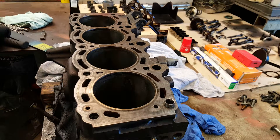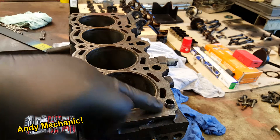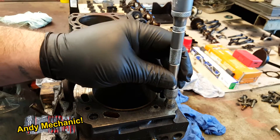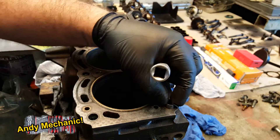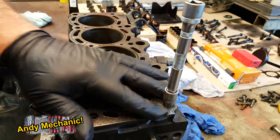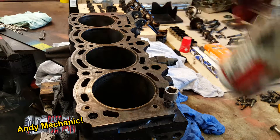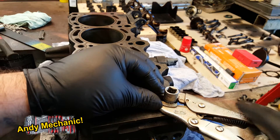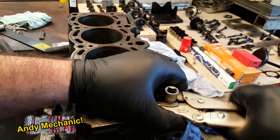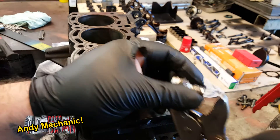This is the remaining dowel on the RAV4 block. I want to get it out of the way so I can run the straight edge across where that is. Just pop your socket on there — make sure you've got your verniers out and confirmed it's a snug fit and not too tight, otherwise you're going to splay this. Just tap it into place. Don't go too far down because you need some space for the mole grips. Pull out the extension bar, then just get your mole grips or vice grips and clip those on. Just give it a little twist, and as you're turning it, put some force to bring it up and it'll come out of the block. There you go.